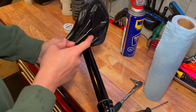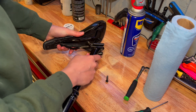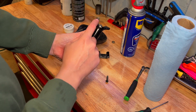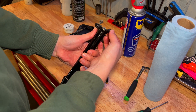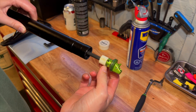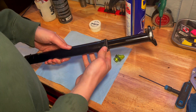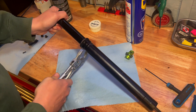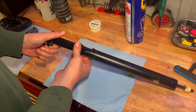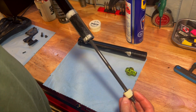I'm going to put this back down and take a 5mm Allen key and just remove the rear bolt here. And everything else will fall apart. Now depending on your frame, if we can get away with leaving or not adjusting this front bolt here, that means when we put the saddle back on the seat is going to be in the same position. Next up, down the bottom here there are two little Allen key screws — I'm going to remove those so this can come off. Now we're going to loosen this collar up here. It's with the saddle still on to loosen up, but we're going to loosen this collar — that can slide up. Now this outer tube can come off and you can see the internals of the seat post.